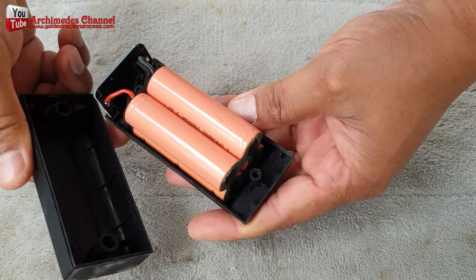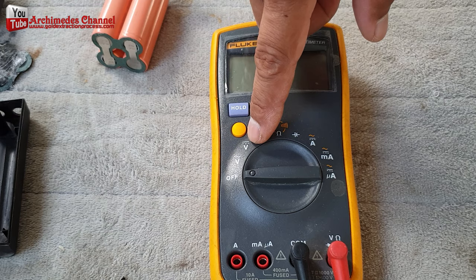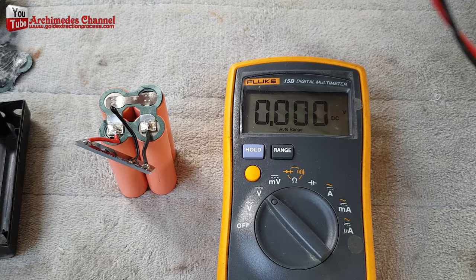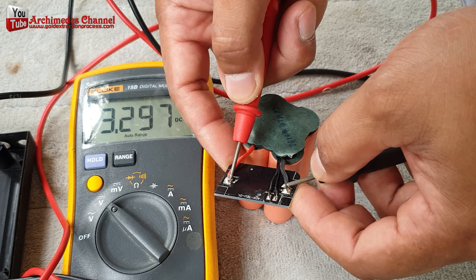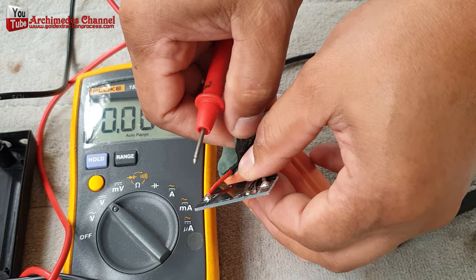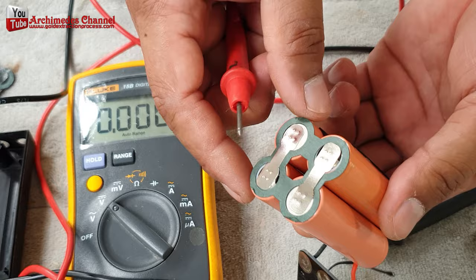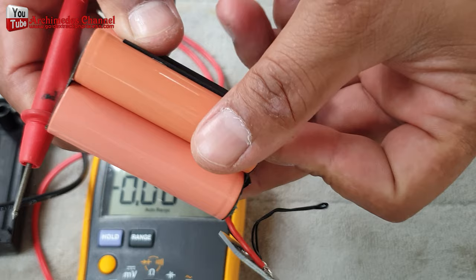Usually the ones I found have 4 internal batteries connected in series. Usually one battery has a voltage of 3.2 to 3.7 volts. I used a voltmeter to measure the voltage on the battery. I have detected one battery with abnormally low voltage. It's a broken battery.